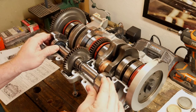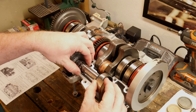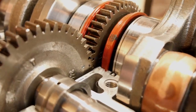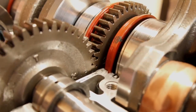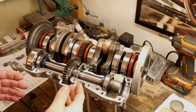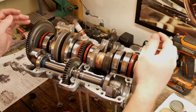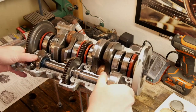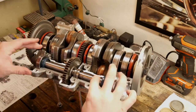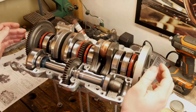This hole needs to be up when the shaft is installed into the case. When you're installing these shafts into the engine, be careful not to nick the bearings or anything like that. We can see those two marks as they come together — the two blue marks right there on the two gears so we know the counterbalance is in sync with the crank. Once we have the shaft in, we want to make sure that everything rotates smoothly. Make sure all the bearings and the seals are seated well, and make sure both of your pins are in, which they are here. Everything's turning smoothly.